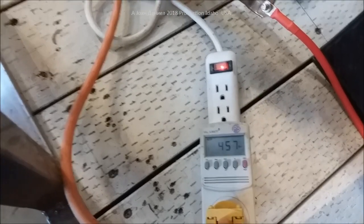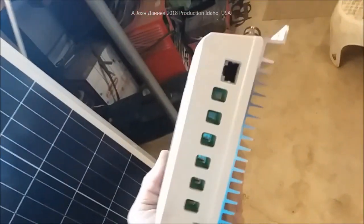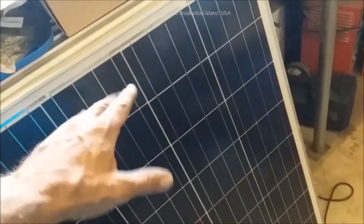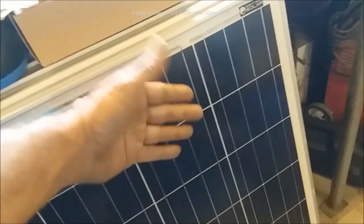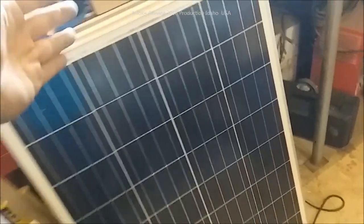We're running about 450 to 500 watts of power. Over here is 800 watts of solar - two MPPT 40-amp controllers on here. These panels tested out within spec - the lowest I had was 102 watts, the highest was 109 watts. They perform, and they're four bus-bar so they really absorb the light even if they're laying flat. With two or three bus-bar panels you need to angle them more towards the sun, but four bus-bar helps a lot in collecting at a flat angle.